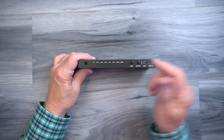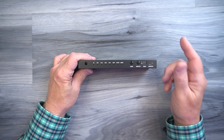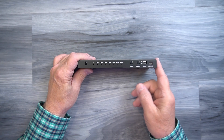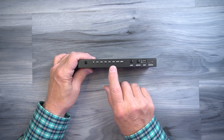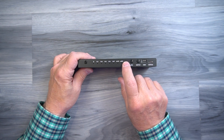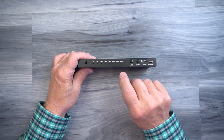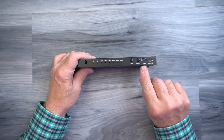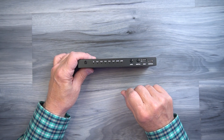To the right of that is an output indicator. The minute you connect to an ultra-high-definition monitor with an HDMI cable, that connection is checked, and once verified the output indicator comes on confirming a solid connection. This product has auto-selection capabilities — in automatic mode the unit selects which input is sent to the output, typically the first one that comes online. It is also eARC and ARC compliant, and you can turn that function on by tapping the button. To the right of both buttons is a bank of EDID switches used to change the audio style, frame rate, and resolution of your input versus output media, as fully explained in the manual.